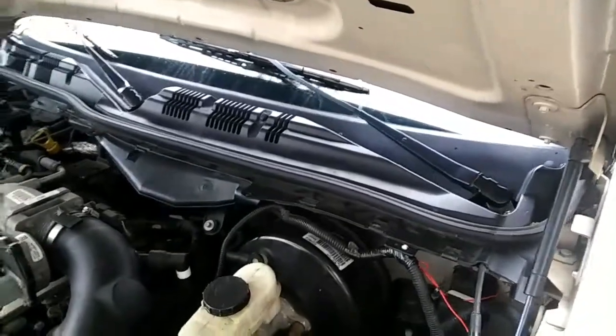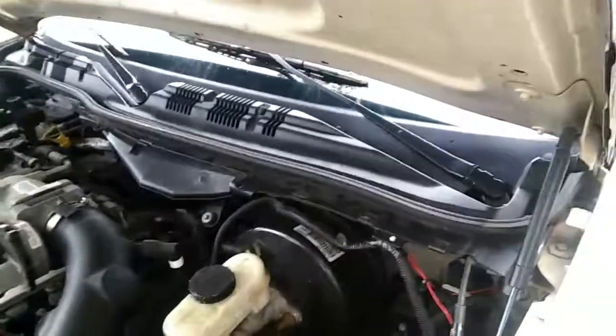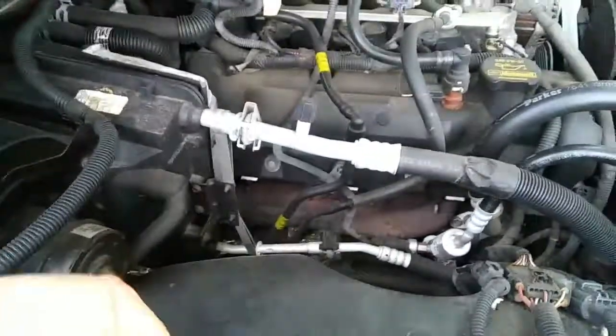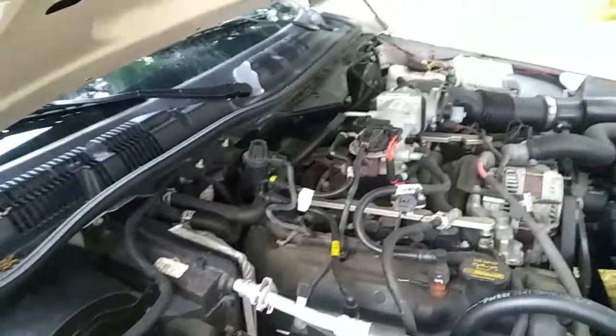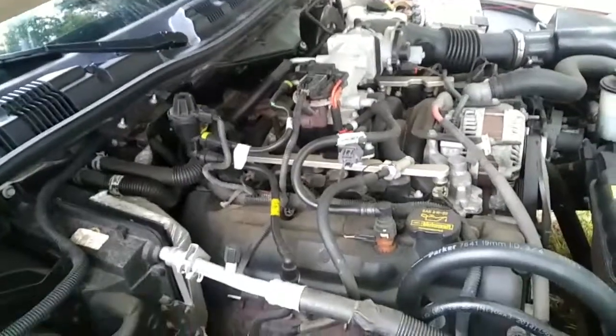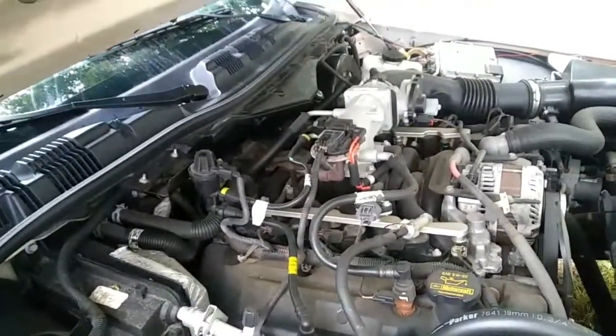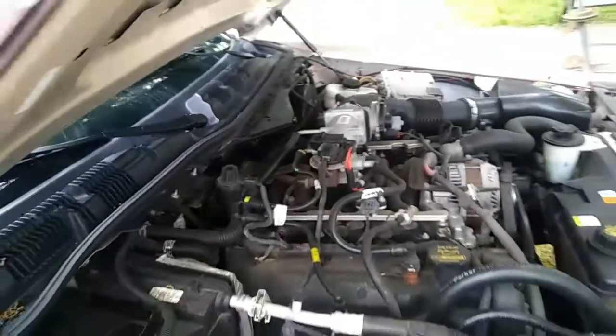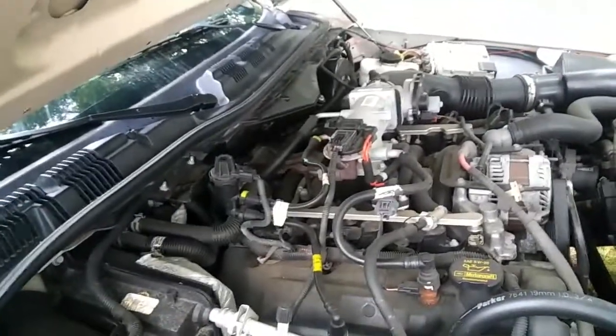That's pretty much it with the wiper issues of the 2009 Crown Vic. I don't know if you've had similar problems, but if this helps you, all you need is a fused switch to temporarily fix this, which I already had run because of my fog lamps. Probably not the best place for these wires at the moment, but they're only temporary until I can get the wires tracked and figure out exactly what happened. I already explained what I believe happened and what my technician, my buddy Dave, thinks. So, it's quite simple. That's how you fix that. You run power, you splice it into that green wire, and that'll get you on the road.